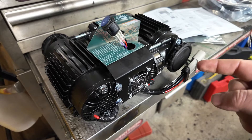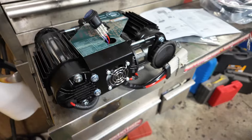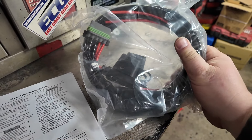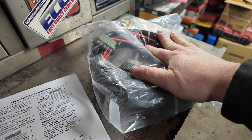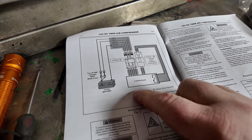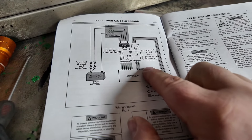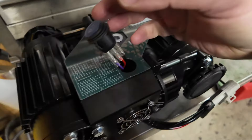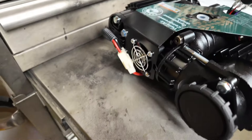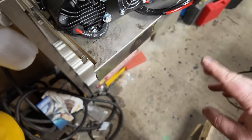What I want to do is have my aux beam inside the Jeep so that when I press the button for the air compressor it powers on — rather than jumping out of my vehicle, turning this on, leaving it on, forgetting it, and killing my batteries. That's what I want to do. This is the wiring harness that came with it — super heavy duty and beefy. I've got a bus bar and some other things to install. This is kind of the wiring schematic: one ground to the battery, then the ground splits. The black and purple wires are the ones that operate it. Dual fan, air connection in the middle — this should provide all the air I need for my Jeep.